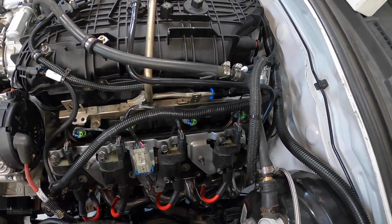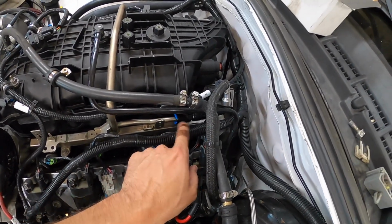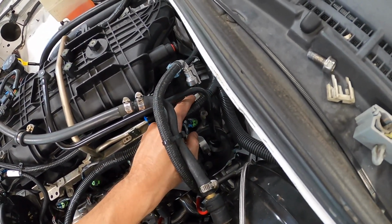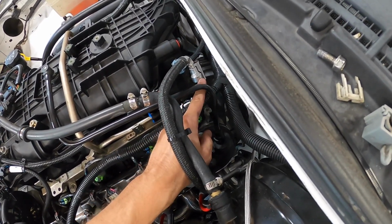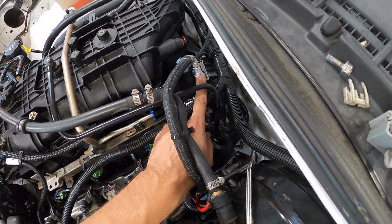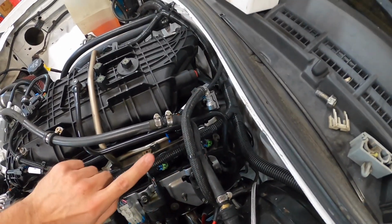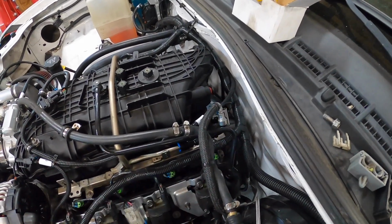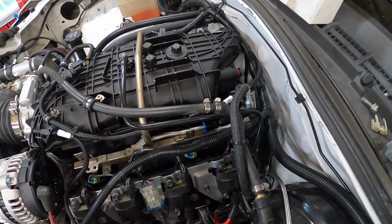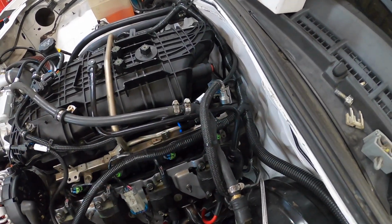It looked like it wanted to kink too much. So what I ended up doing is buying a couple AN fittings. So I have a 3/8 quick connect to 6AN, 6AN female to female, and then a 6AN to 3/8 90 with the fuel fitting on the end, like the 3/8 male fuel fitting on the end. So this together on the factory fuel rail basically just extends the length of the factory rail, and also gives me a 90 on the male 3/8 fitting, which, putting that on and then connecting this, made the top portion of the Colorado hose a lot happier.